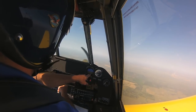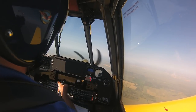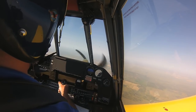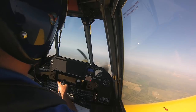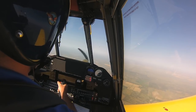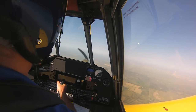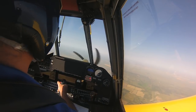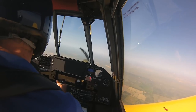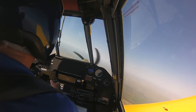Same thing for yaw — I'm going to hold the wings level and remove my feet from the rudder pedals. Feet are flat on the floor now. I'd say we've solved the rudder trim out-of-trim condition as well. The ball is right there between the lines. So I'd say we're successful — let's head back to the airport.